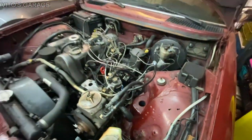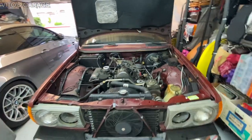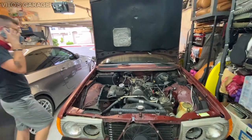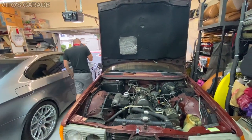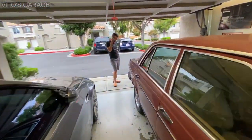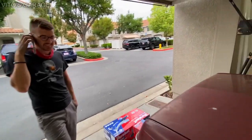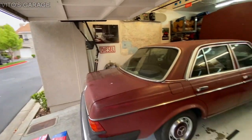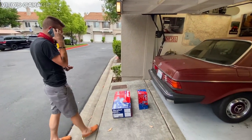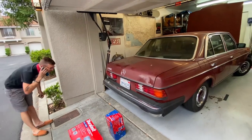I replaced the power steering hose on it too, so just doing a few little things. We tightened up the alternator, so I'll see if that makes a difference. We got into the trunk — a little trick — popped the taillight out but actually saved the taillight. It was just a really long extension through the first aid hole to unbolt the taillight, and then was actually able to get in there that way.